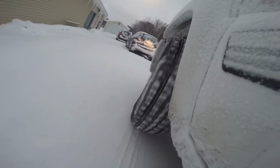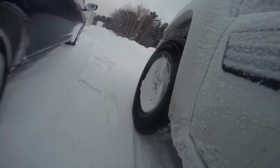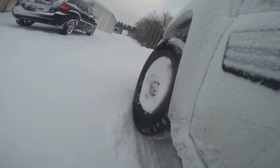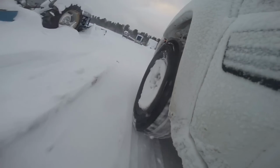So 285, that number is technically the width of the tire. And then, I think this part I could be wrong, 75% of the width is the height of the tire. Meaning just the actual sidewall, from where the tire would meet the rim to the top of the tire. 75% of the 285 millimeter width, follow me on that, is that section of the tire's height. So I don't know why they do that. In layman's terms, it's a 33 by 11.5 by 16.